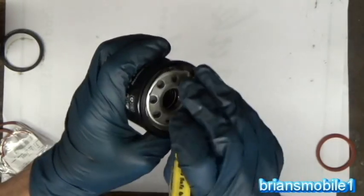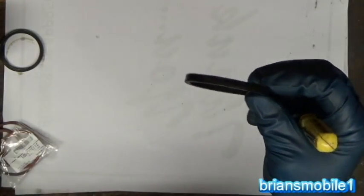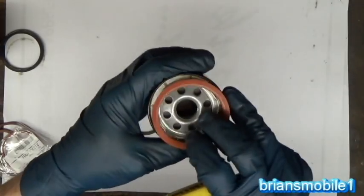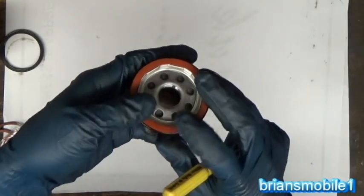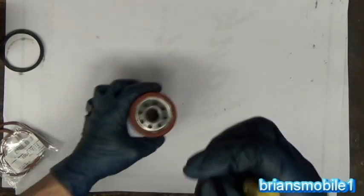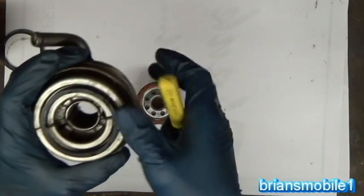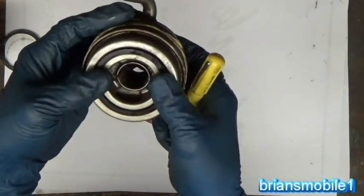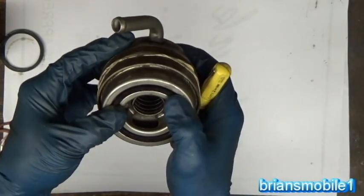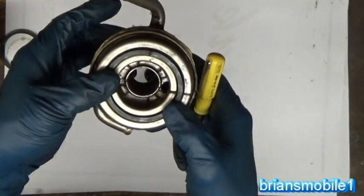Here is an o-ring from the oil filter for the WRX. You can see this is too thick and too hard. Even though they're interchangeable to a degree — you could probably use the orange one on the oil filter and get away with it — the problem is if you try to use one of these on your oil cooler, it fits in there but it's going to leak because it's going to bend over or lay over. It sticks out too far and it's not as supple as the orange one; it's much, much more stiff.